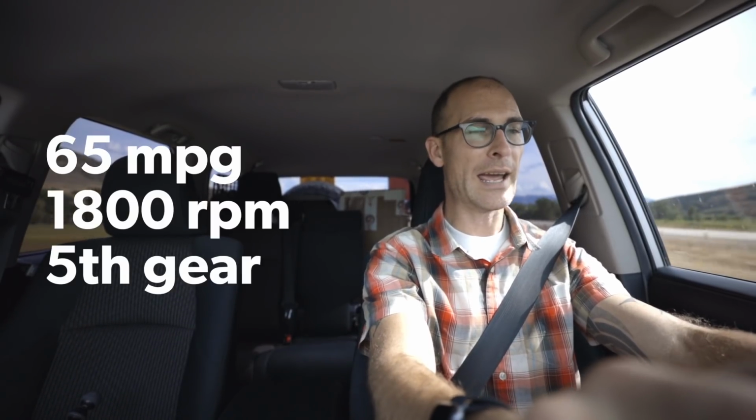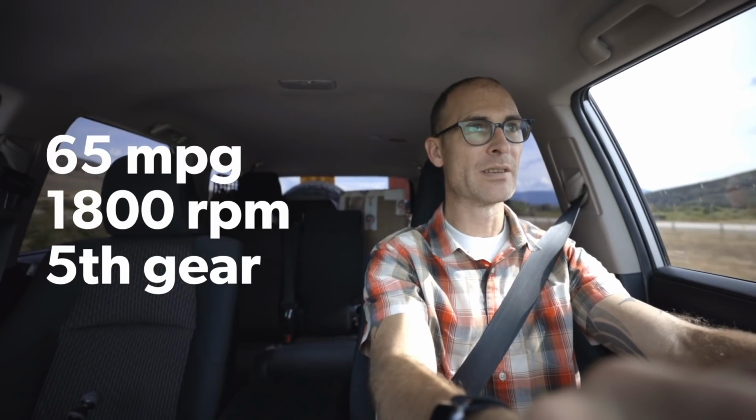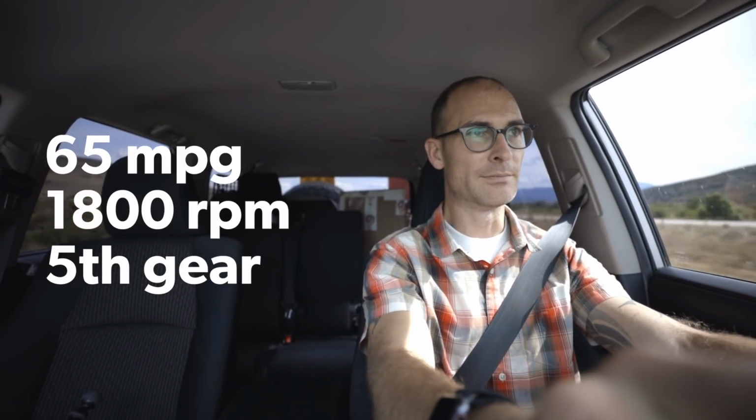All right, 42, 2nd gear, 4,000, 4,500, 55, 5,000, 60, somewhere around there. All right, speed limit 65, and I'm going right at 65. So let's just stop accelerating there. And so I'm on level ground, 66 miles an hour, 65, and 1,800 RPM. Fifth gear. Now I'm going uphill.